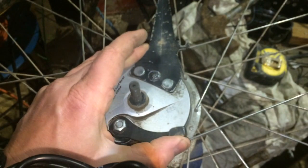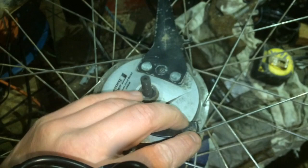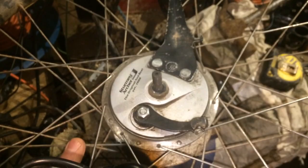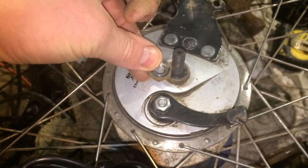This is the little lever here which gets pulled up by the brake cable when you're using it. You run a standard brake cable down through here and there's a clamp which fits onto the brake cable. When you pull the lever, it pulls this one upwards and works the brake shoes inside. So all you have to do to get inside one of these — it's one of the easiest things ever, actually, in terms of taking a hub apart, because normally you need cone spanners and all sorts of things.